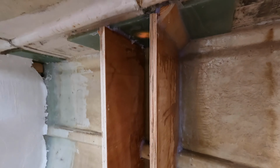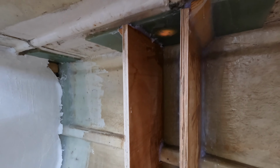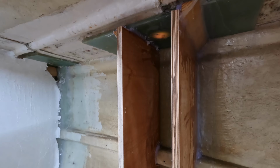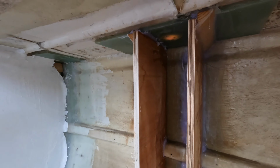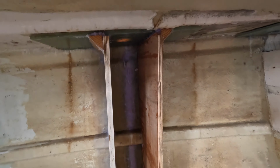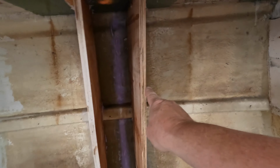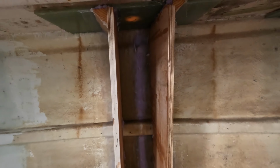and this is already going to be far, even if these are not brilliant, tabbing's not brilliant, compared to the original, which was one bulkhead with a bit of stainless steel bolted to it. This is going to be a lot stronger and better at diverting the loads down, because each of these could only be taking half the load.